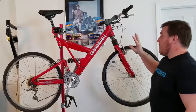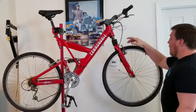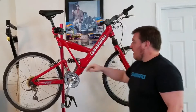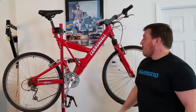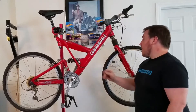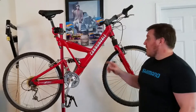Now, onto the abandoned part of this bike — because it is very much abandoned. Not only does the fork barely turn, it's frozen. The brakes don't work very well — this side is moving but this side is completely frozen, which is not a good sign. The rear is the same: one side works okay, the other is completely frozen. Luckily, the frame shock has already been upgraded with a pretty nice heavy-duty spring — it's a Fox Vanilla R, looks like a '99 install.